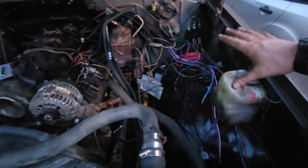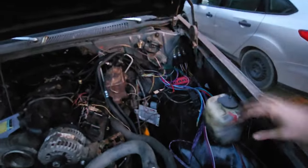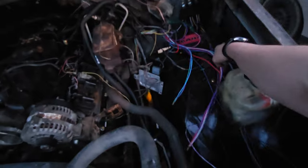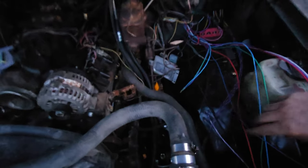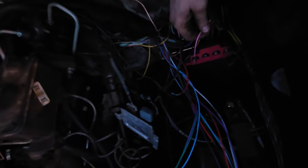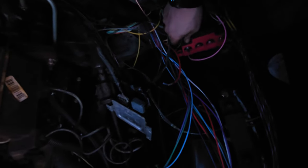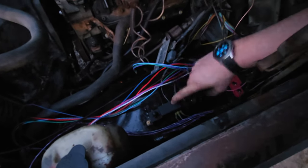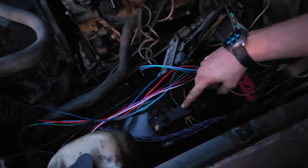So, up in here looks a bit different because I cut all this out. I have my wires that are hot, and I have my wires that are not a hell of a lot. Sitting up there. Down in here, I have these, which are my turn signals and all that, all hooked up. So right here, all my pink wires going into a keyed on, which is in here, which is this pink wire right here. It is a coil connection. This is my orange wires coming into a constant 12 volt. I don't have it hooked up yet. I have every one of my grounds hooked up into a single two battery ground bus bar.